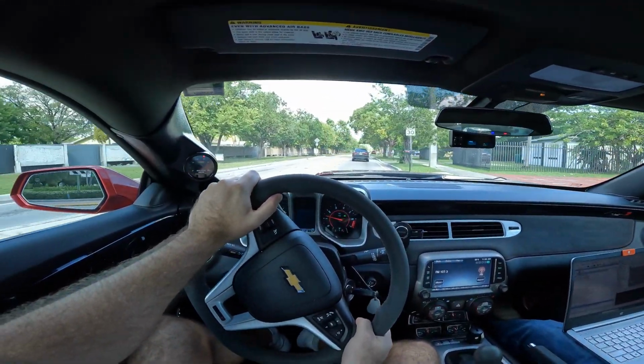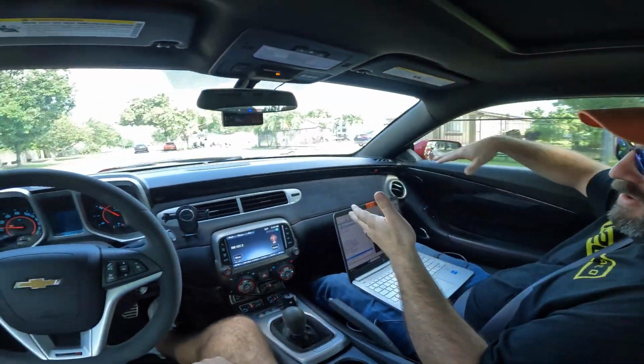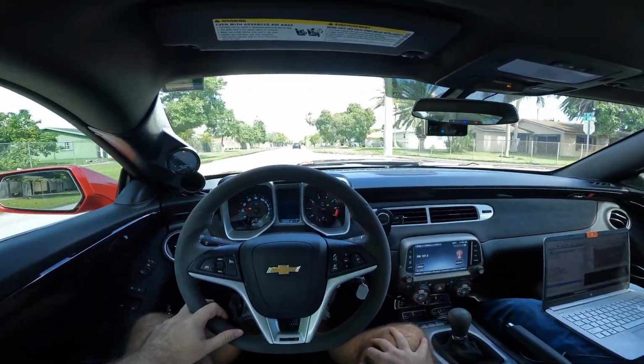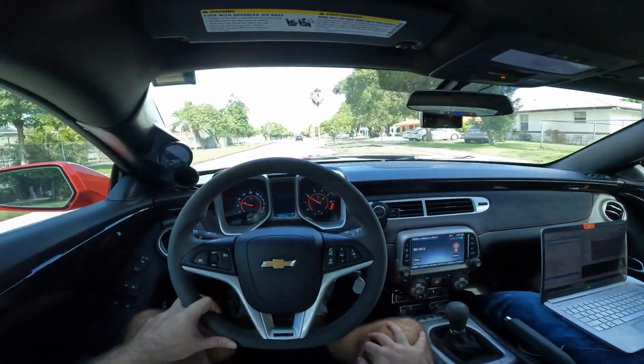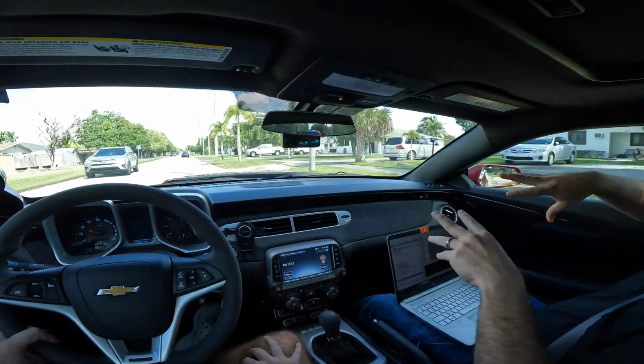That's what I mean. There's an intake air temp by the actual intake, which reads ambient air. But there's also an intake air temperature after the supercharger, where it goes through, supercharges it, and passes through the lid. So it's actually the hot air.